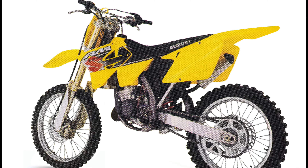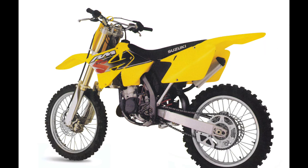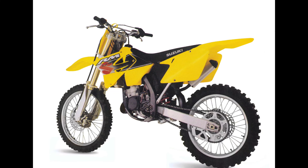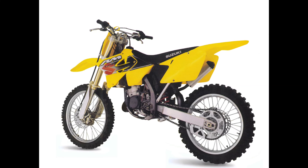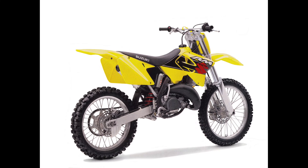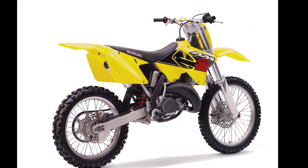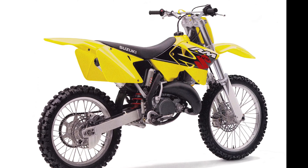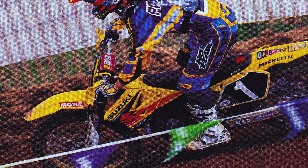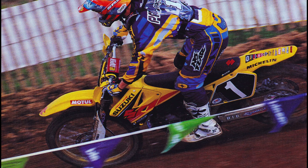On the detailing side, the RM was better thought out than previous Suzuki designs, but still a tick behind the best bikes in the class. The redesigned bodywork was well-liked for its appearance and fitment, but the new thinner plastic was flimsy and not particularly durable. The stock graphics were even worse and destined to be shredded within a few rides. The new clutch offered a super light pull and smooth action, but not much in the way of durability — even a moderate amount of clutch abuse left it slipping and begging for an aftermarket upgrade. Overall reliability was improved over previous Suzuki 125s, but it remained the quickest to wear out. Things like the wimpy stock chain, butter-soft sprockets, and chintzy steel bars made the RM feel cheap compared to bikes like the KTM 125. On the positive side were the RM's excellent ergonomics, sexy looks, supple suspension, powerful motor, sharp handling, and strong brakes. In 2001, Suzuki provided an excellent basis from which to build a title-winning package — out of the box it was fast, well-suspended, and competitive with anything in the class.